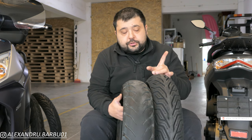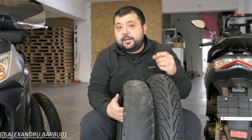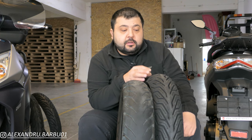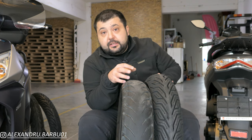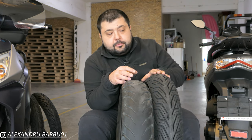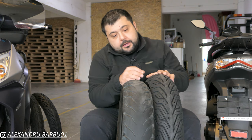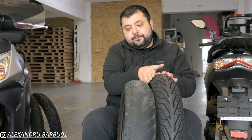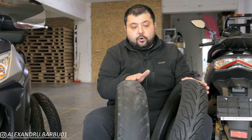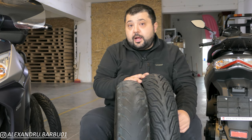It was about halfway through its life. Also, being a premium tire, Michelin has the budget to engineer a more complex compound — you have more plastic in the middle of the tire, giving you better lifespan since most of the time you ride straight, but a higher concentration of natural rubber and silica on the sides. So when you lean over, you have the grip. When you're going straight, you have low rolling resistance and you get high mileage out of them.